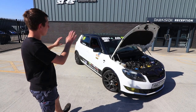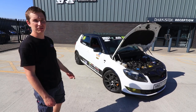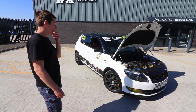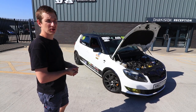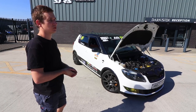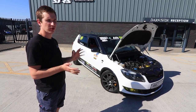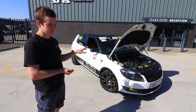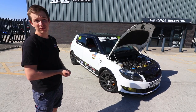His stickers, so there's that many on there, I'm not sure what's what. More stickers than mods on his car, I know that for sure, and he's got a lot of mods. So basically he's been running around with a PD CR170 turbo, which we sell as a 175 upgrade for these, which normally go up from 165 to 175. He thought this had 200. We put it on our dyno, it did 170, so it was where we expected it to be.